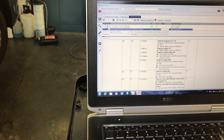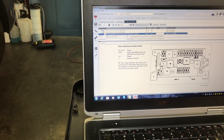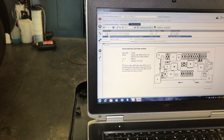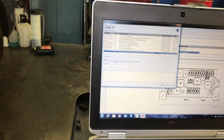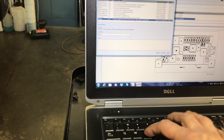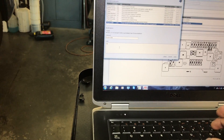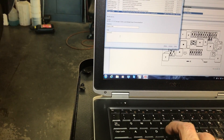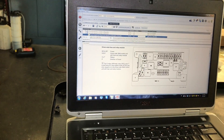These are the fuses that I need. I know that I need to have power at fuse 43 and fuse 59 — 59 is in here and 43 is in here. I already checked that and it's fine. Let me save the bookmark because I want to show you guys that too. You open Sentry, click there, and put a keyword so I remember — I'm going to put 'engine SAM.' I know it's a front SAM but okay. And in the note I'm going to put 2009 E320 Bluetec. Like that, I saved the information so I can go back to it.